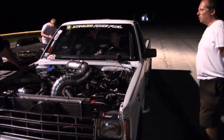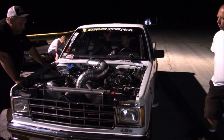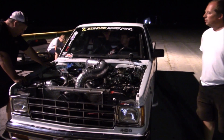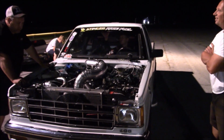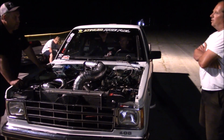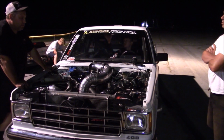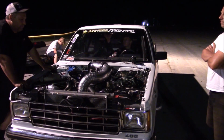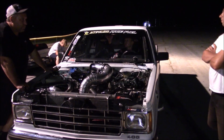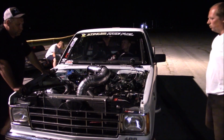Crazy seeing the size of the discharge pipe for those things. What is it, like 2 1/4? I think so. I hope we made the right choice putting those on. The 40mm wouldn't work. It just can't control boost. It just comes up regardless. Yeah, it'd be too much boost. So if you didn't have a choice, at least you know you're not suffering for nothing. If you have to fight to make them work a little bit, it's worth it because you couldn't use 44s.